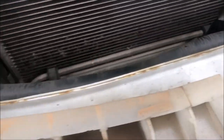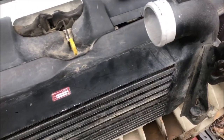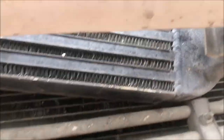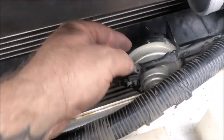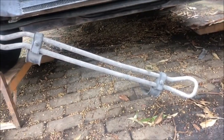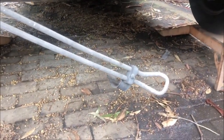We'll work something out just to make sure we don't have too much heat going into these pipes. I need to figure out what to move from inside here to get my intercooler in. I reckon that horn's going to have to go. It's a genuine Garrett one, which is really cool. I think I've found how it goes in — there's already holes for it, and they're behind the bumper rail. This is a power steering cooler, believe it or not, and it is in the way of the intercooler. Intercooler's mounted — I was actually able to mount the horn back in its factory position, which is fantastic. The only thing I haven't worked out is this stupid cooler. Is it even necessary if it's only for the power steering? I'm sure there is a solution.